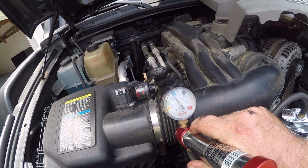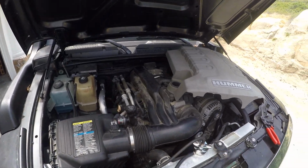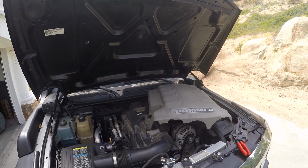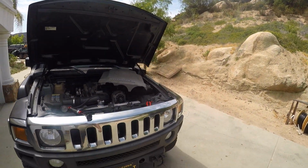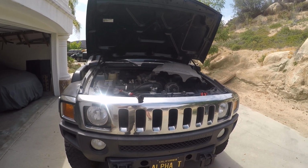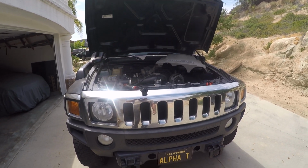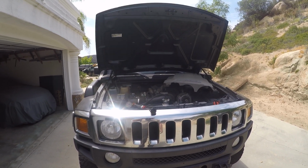So, basically right now my advice would be clean this thing up, whatever you got to do, and then by the time all that work is done, re-inspect for leaks, recheck your pressure as just kind of a guide. If you see no leaks, go ahead and top the coolant off, and a road test would certainly be a good verification, because if there is another leak, it loses coolant, it overheats, it dies on the side of the road. That's an unhappy customer. Maybe a tow bill, maybe a blown engine. If it overheats so bad, they may warp and damage things. So this is a pretty serious high risk kind of a deal.